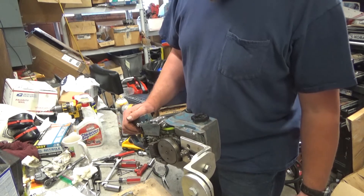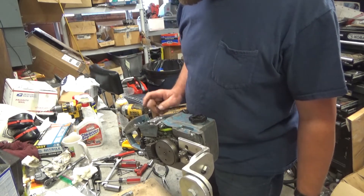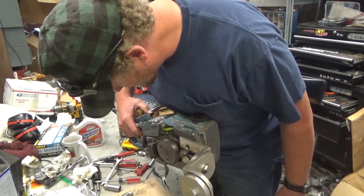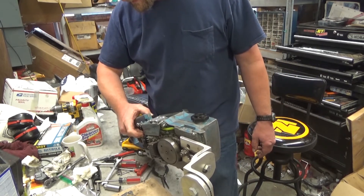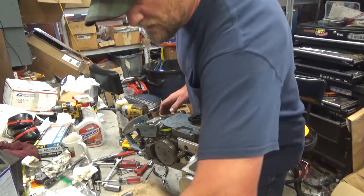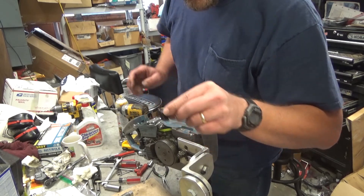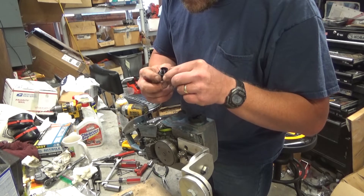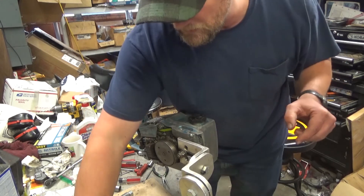I'll get the oil line done. Got the new manual oiler button back on here and I'll test that — it sounds good, I can feel a little bit of a pulse right here so it should be working okay. I do need to get an oil cap; this one has enough broken edges on it that I'm not sure even a good O-ring is going to stop it from leaking, so I'll see what I can find for an oil cap.